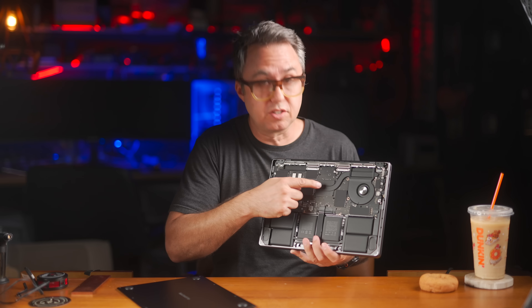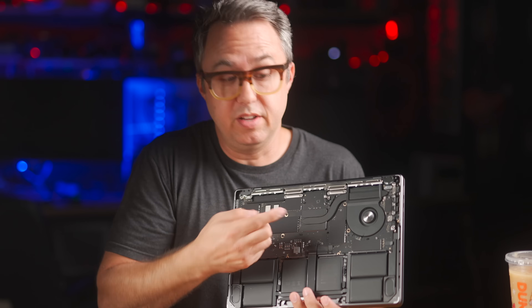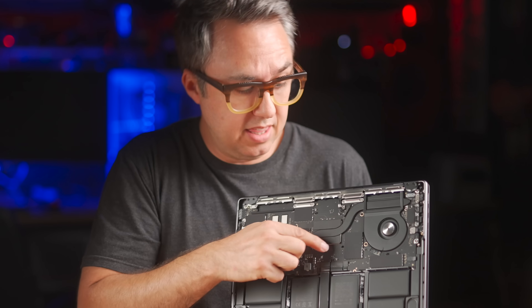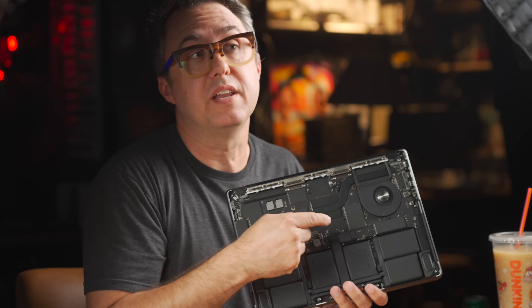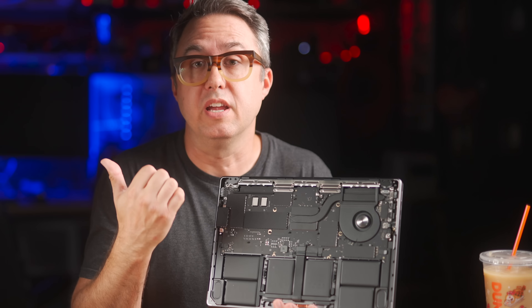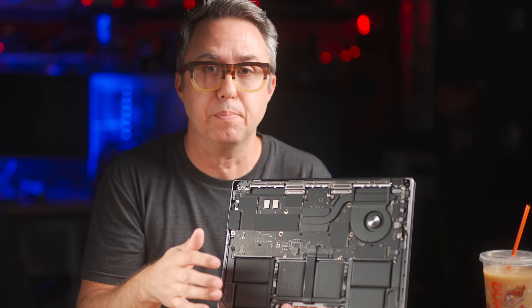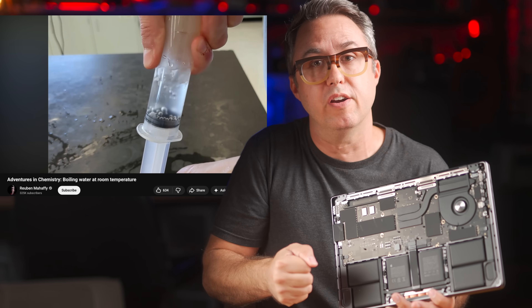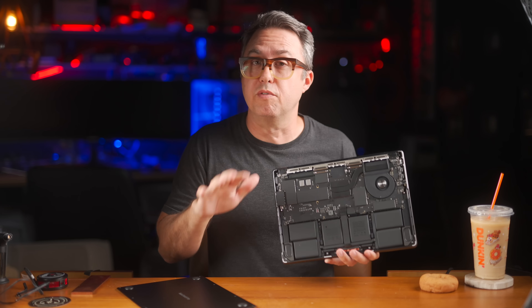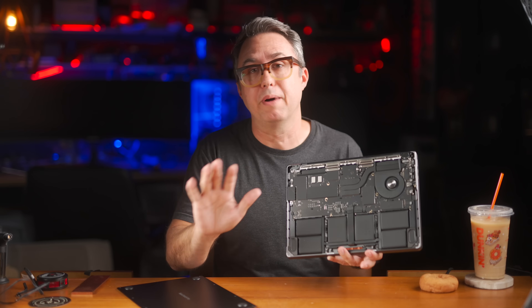Here's how it works. Inside the MacBook Pro this tube is made out of copper and it's hollow. At one side is the CPU under a copper plate that transfers all the heat from the CPU onto this tube. Inside this hollow copper tube is just a little bit of water, but importantly the inside of the tube has most of the air sucked out of it — it's under a vacuum. There's this mystical property of liquids: when they're under negative pressure, you can make water boil at room temperature. More vacuum means a lower boiling point of liquids. So this little tube is under vacuum inside, and the water inside can turn from liquid to vapor at much lower temperatures than normal — like 50°C. I made that up; I don't know exactly how low.